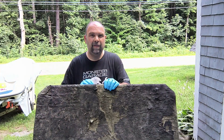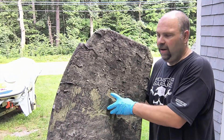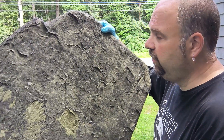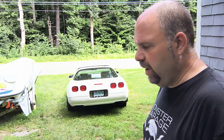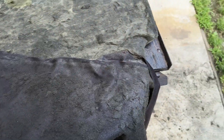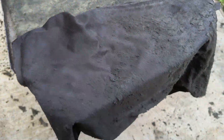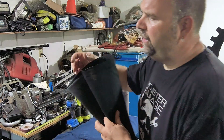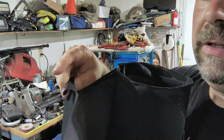As you can see, this is a really, really messy job. Don't do it inside if you don't have to. I highly suggest wearing a mask, even though I didn't. You just want to get all the loose stuff off. I took it down a little too far in the middle, but that's alright — it's going to be covered up. You want to get all the loose stuff off so when you put the glue on it has something to adhere to. But at the same token, you don't want to ruin the headliner card itself. The old fabric has the foam built right into it, and over time it just lets go. So I bought some new headliner material from my local fabric store, and that's what we're going to use. This new headliner material has the foam backing, just like the original stuff.